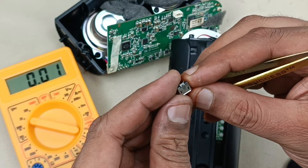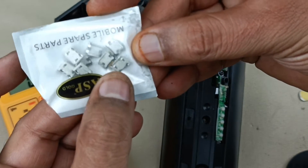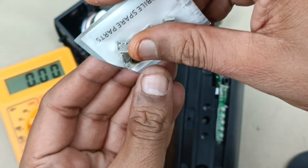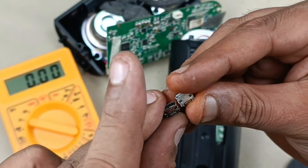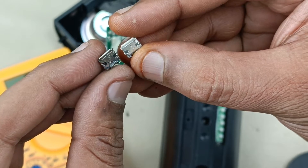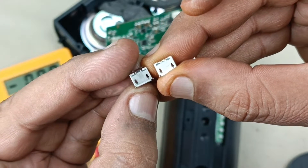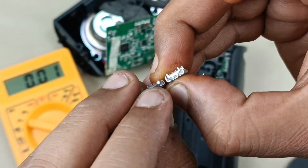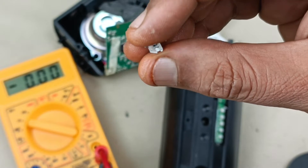So I am not going to put this same pin; let me put a new pin — because here you can see the pin is broken. I have an extra pin here, so let me connect that. I have the same pin which is a JBL Flip 2 USB pin. This is the exact same pin, like original. You can see — this is the top view — it is 100% similar. You can see the difference: the old one is bent, the new one is clean. So I am going to fix this pin; hopefully the voltage will come and the speaker will start working again.